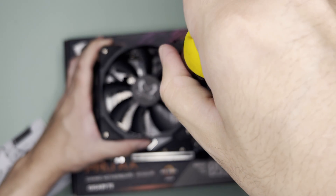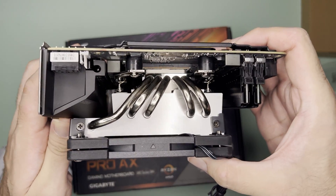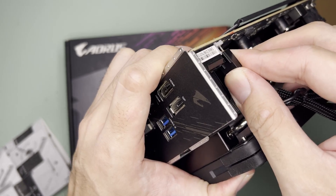To mount, turn the screw three turns at a time until it is fastened. While mounting, double-check if you have proper contacts. Lastly, plug the fan to the fan header.